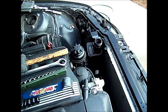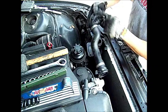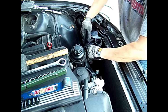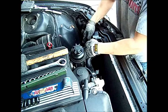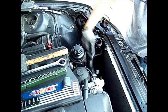Finally, put on the upper radiator hose — connect it, make sure all the clips are down and all the connections are clean. These two over here will connect at the same time; just snap them in like that. Two snaps in this one, just one snap on the other. And there you have it.